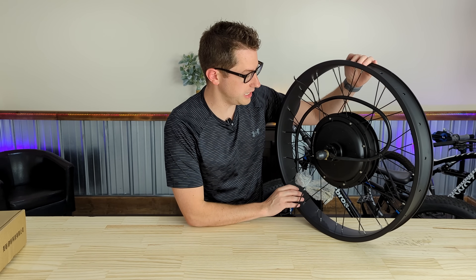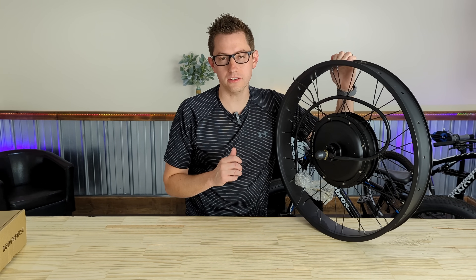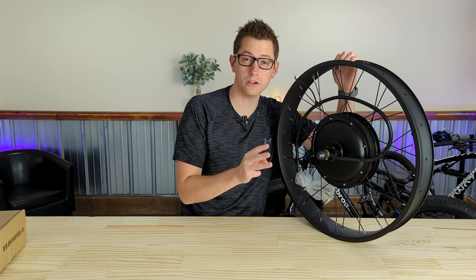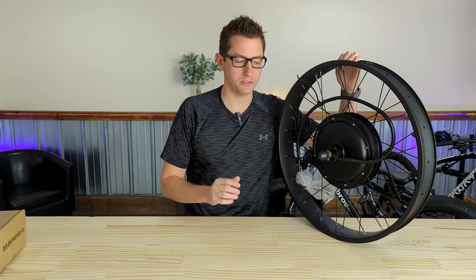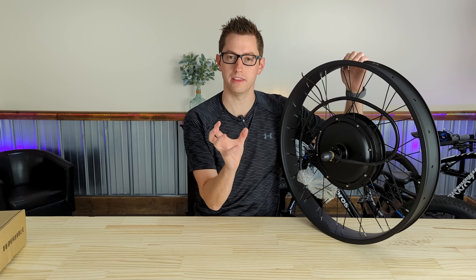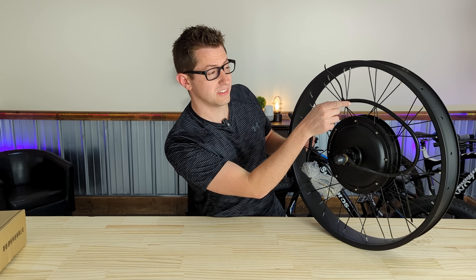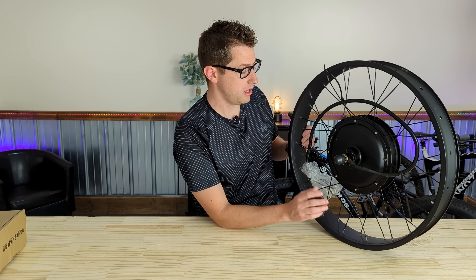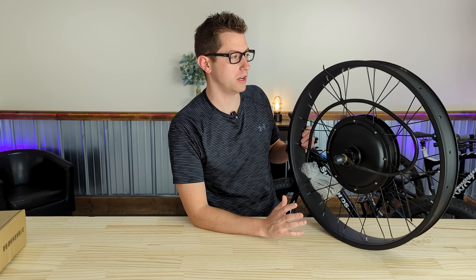This is the core of our build. It is a 5,000 watt 72 volt hub motor, and this motor actually is a four turn. If you look at these online, you'll find a lot of three turns for high speed and five turns for high torque — I wanted something right in the middle, so I had them customize me a four turn motor. I'm hoping that's the sweet spot, the Goldilocks for e-bikes. As far as brand, I have no idea — it has a little sticker on here that says Power Circle, so that's the closest to a brand that I know.